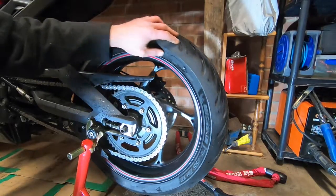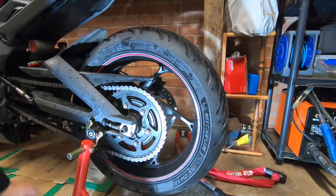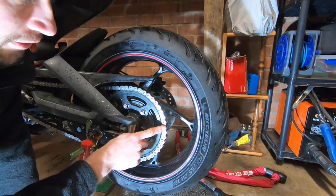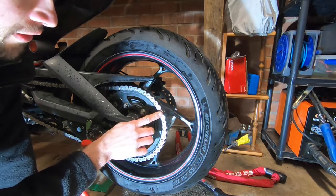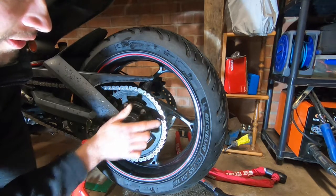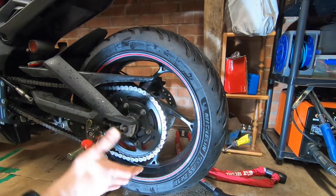The easiest thing for me, I find, if you ever want to shorten a chain, is to just move it around onto the sprocket. That's obviously the original hollow link, so I'm going to grind that off, and then I want to lose a link, so I'm going to grind that off, and then essentially one there would be gone. So it'd just be like that one there was closed up to there. Move this in about 15 mil because it's 30 mil altogether.